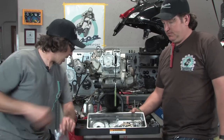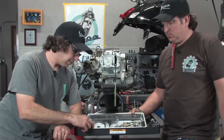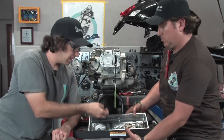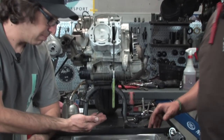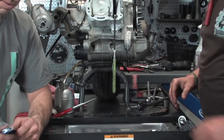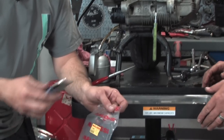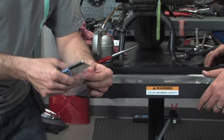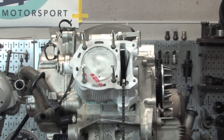And next thing we want to do is put those O-rings that we were basically catching up on the threads. There's four of those new O-rings. There's a trick to installing them, along with how we removed them here. Basically, the little bag that's included with your Malossi, any bag. I'm excited about this trick. So basically, you just want to cut a little plastic condom. Sure, we'll call it that. There you go. Stud condom.